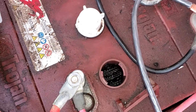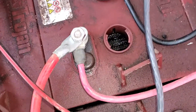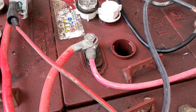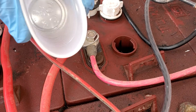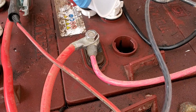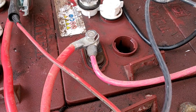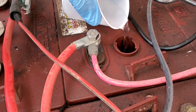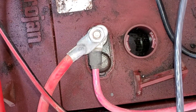I found one that needs it — as you can see, the plates are exposed. It doesn't look too low but definitely needs some water added. The way I do it is with a small disposable cup — paper or plastic ones like this. I like it because you can fold and squeeze it a little bit so it pours more accurately. I'll go ahead and fill it up and get some water in.